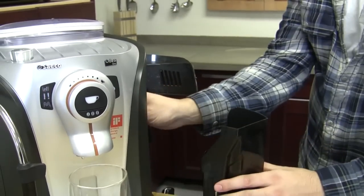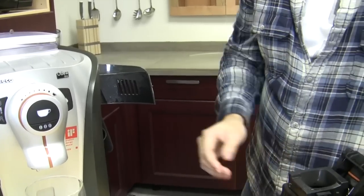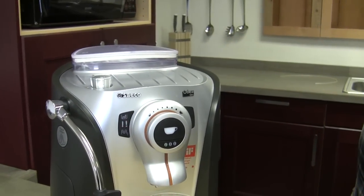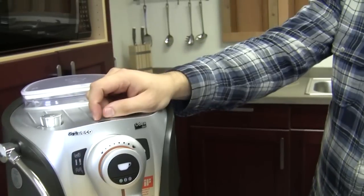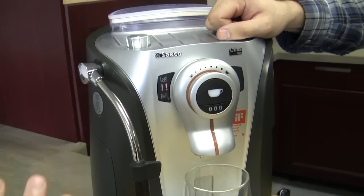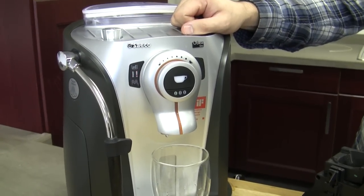And the fifth is simply your brew unit itself. I'm taking this out and shutting the door, but we still have that alarm — it's because this part on your brew unit isn't hitting the micro switch that's back behind the brew unit. So if you're getting that alarm you need to check all those things — and then also what happens if you're out of water or anything like that.